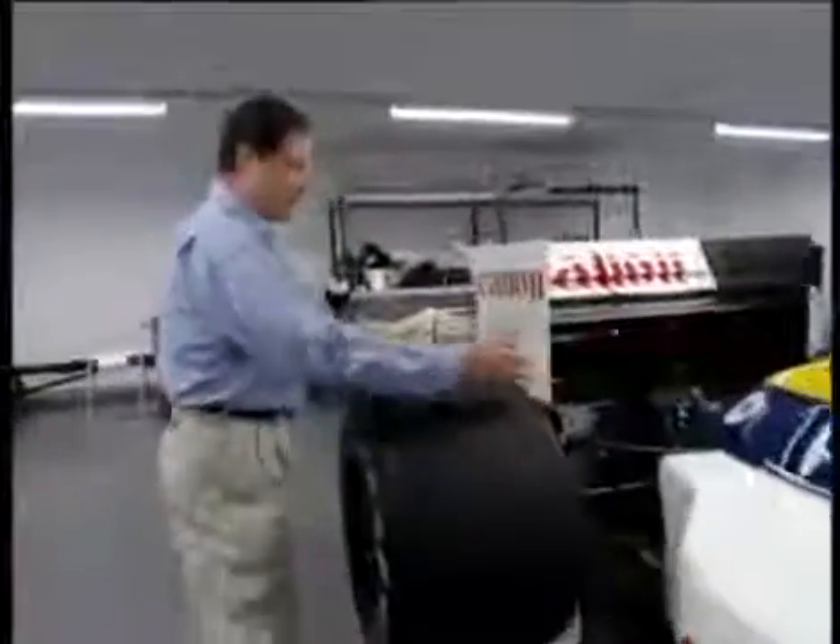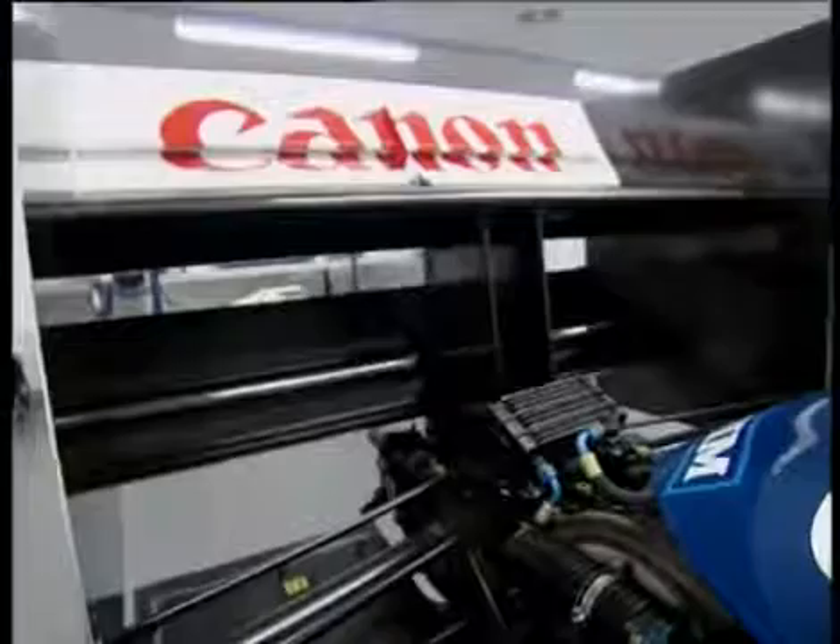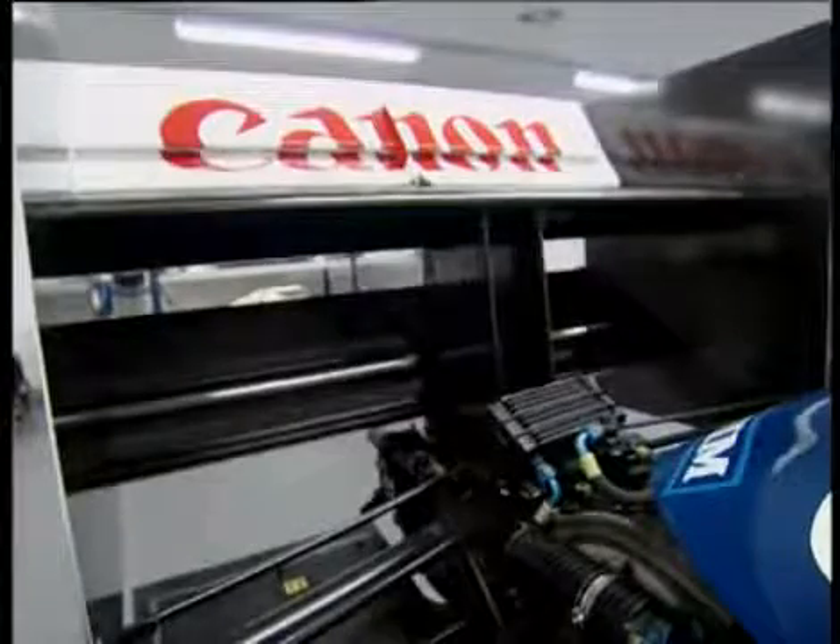Round here, you have the problem of letting all the hot air out from the engine, from the radiators, and still maintaining good downforce from the wing. Everything ahead of this rear is all orientated about not upsetting the flow here.